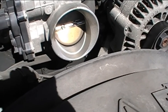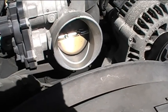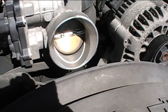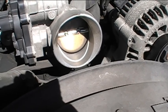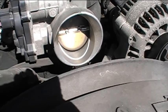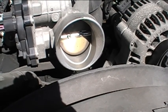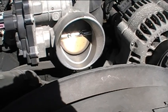After thinking about it, I believe this screen is used to make a straight airflow for the mass air flow sensor, which is on the other side of the screen — to ensure the airflow is as turbulence-free as possible so the sensor can get an accurate reading. Now that we've removed the air intake assembly, you can see the throttle body and its valve. As you step on the gas pedal, the valve opens more and more to allow more air into the engine; releasing the pedal closes it. That's basically how you control vehicle speed — by opening and closing that valve.